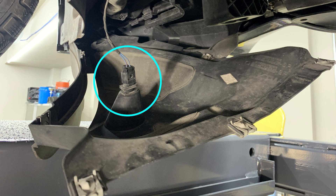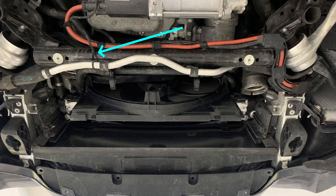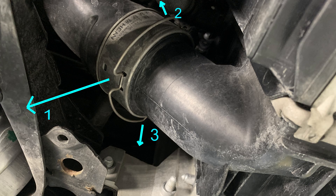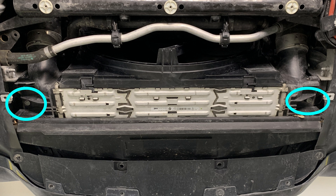The one on the driver's side of the car has a connector that you need to remove — I think it's a ride height sensor, so just be wary of that. Use a flat head screwdriver to undo the two black plastic clips that hold the hose into place, then cable tie it out of the way. Use a flat head screwdriver to undo the two clips that hold the pipes onto the intercooler. These need to be pulled outwards from the center of the clip and then the sides need to be pulled away from the pipe. Then the pipe should slide off with a little bit of force — do this for both sides. The clips will look different if you have aftermarket charge pipes, but the principle is identical in removal.